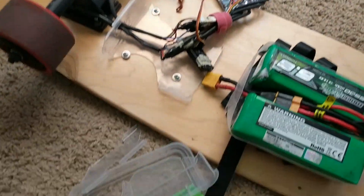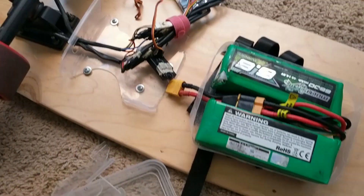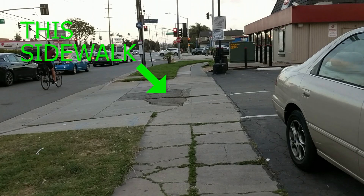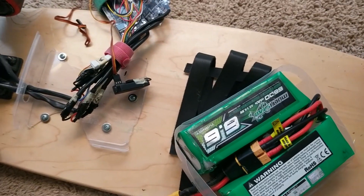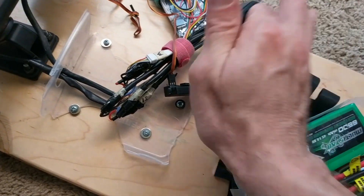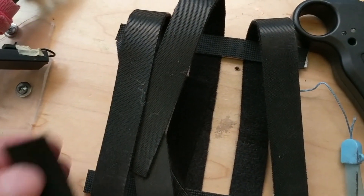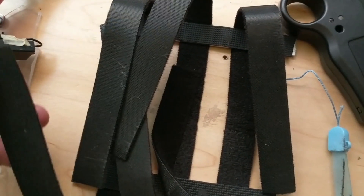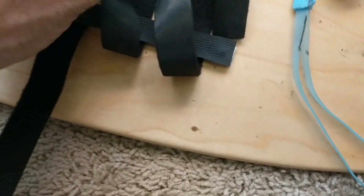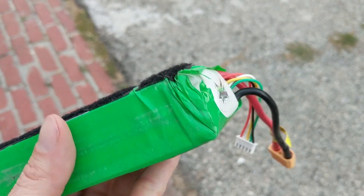Securing the battery well was one of the lessons I really learned the hard way. I originally used weak Velcro designed for cable ties, and eventually the battery fell down when I was riding on a rough sidewalk. The battery could have fallen and got pushed into the ESC and cracked everything. The remote was in my hand and went right into the pavement — my guess is the Velcro just popped right off. This method might be okay, but you have to be really careful to use strong Velcro. Surprisingly, neither battery caught fire. I think RC batteries are built pretty tough, but I'm definitely not using those anymore.